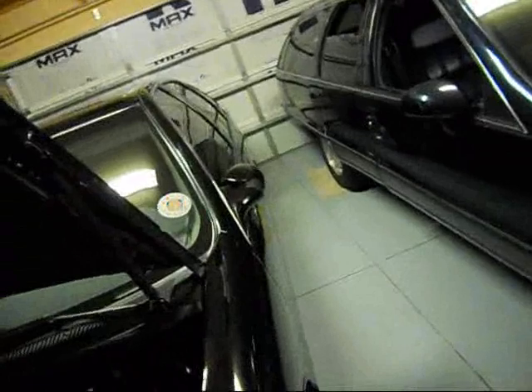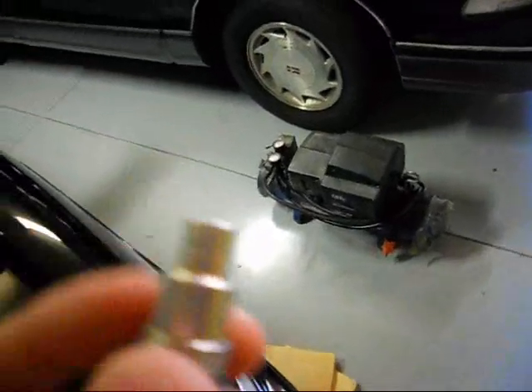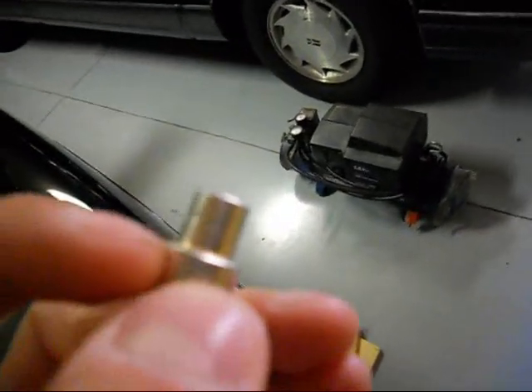Had a little rattle on the back too. Let's hit the wagon. There's this little thing on the parking brake cable that was loose, so I put two zip ties around it and solved the crazy rattle I had on the right rear. So that's done. It's your little metering bolt — if you had a fancy lathe you could have made one. All you have to do is cut this edge right here the slightest bit, like a 45-degree angle, and it's good.